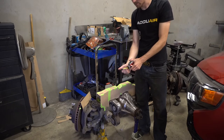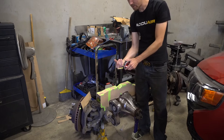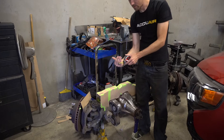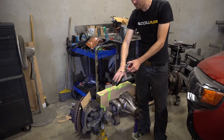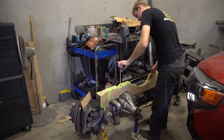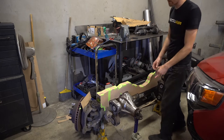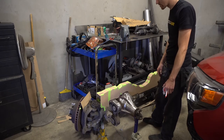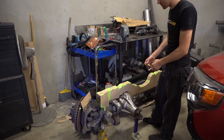And the bag's going to protrude out another inch when it just sticks out an inch past the mount point. So that's awesome. So the frame can be here, and the outermost point of the bag can be right there, past the frame, which is huge, because then it'll be over here instead of over here. There. Way more difference, especially since our panhard bar was only that long, right there, which is tiny, really tiny. And like I was saying before, the panhard bar, with the amount of travel and everything, is a little short, so it'd be nice to have it longer, because then it won't be this big of a deal. And geometry will be better, and the maths will be better and stuff. So yeah.